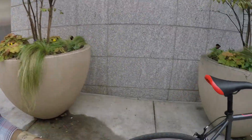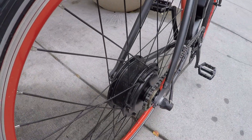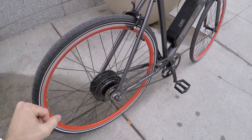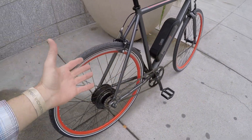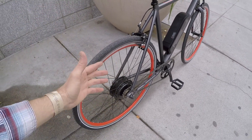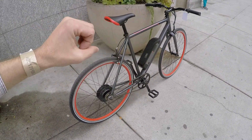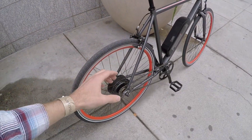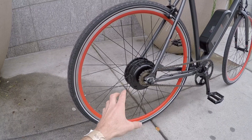At just about the $1,200 price point for an electric bike, not bad — but what are some of the other trade-offs? We've got a 250-watt internally geared Bafang hub motor, versus 350 watts on a lot of bikes these days, or a mid-drive. So climbing, especially with only one gear, is okay, but hub motors aren't quite as efficient or well-balanced as mid-drives. You also don't have the drivetrain wear you might otherwise, but if you get any damage to this rear wheel it's specially spoked.